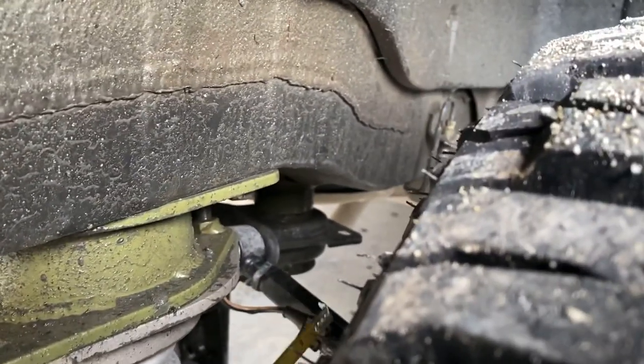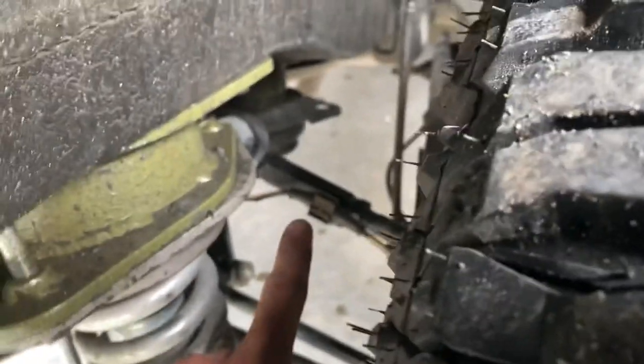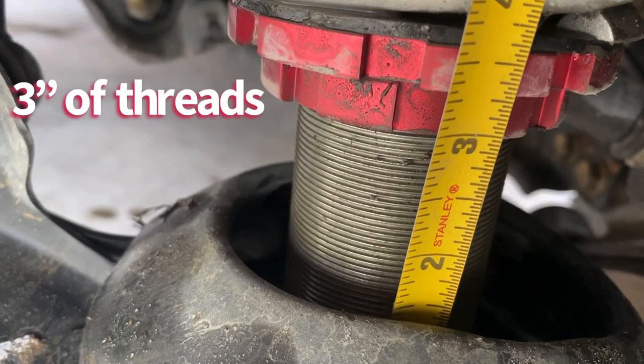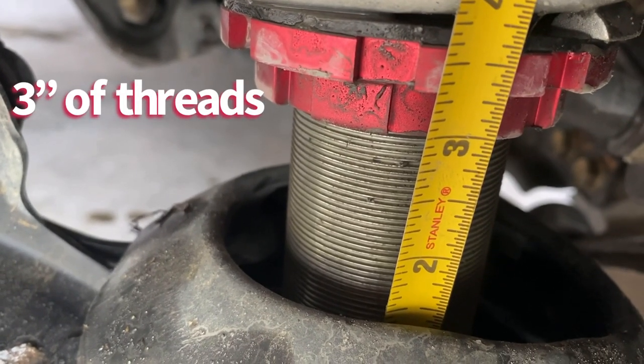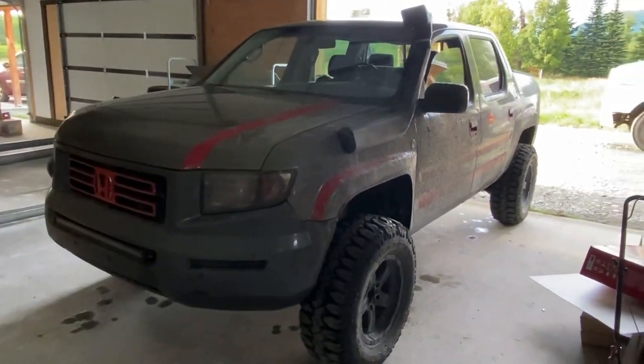If you're going to have this as well as this Flat Out suspension, you're going to need adjustable tie rod ends. You will need those. So have that at right at 3 inches. Again, remember I got a 1-inch subframe drop to help the axles not be as sharp of an angle, which does allow the body to be a little bit higher than otherwise by an inch. So this is the look of Renegade right here with those measurements.